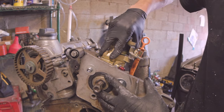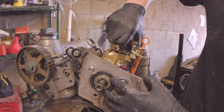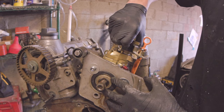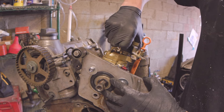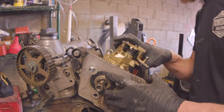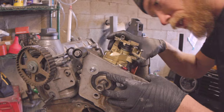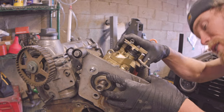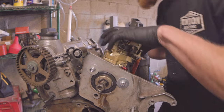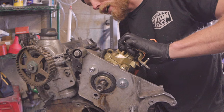I think the spacer is actually kind of fine the way it is. You can see there's about that much play, so I might make one more revision of the spacer to make this a tighter fit with less wiggle. But it does make the pump pivot very nicely. We're going stop to stop — that's the full range of 1.6 timing motion. This back lever is clearing — I don't use it, but it clears now.